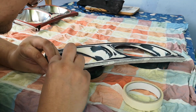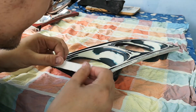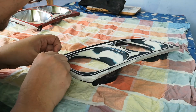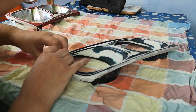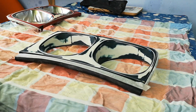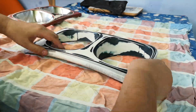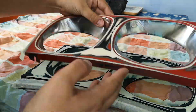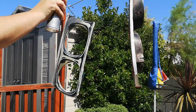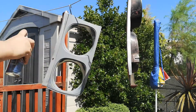What I'm doing here is masking everything up ready for the initial spray. There are in total two rubber seals around the actual lights themselves. There's a large one at the bottom which is not attached on the red one but seems to be present on the green one. I tried removing it but it seems stuck down with quite strong adhesive, so rather than risk breaking the bezel I opted to leave it in place and just cover it with masking tape.